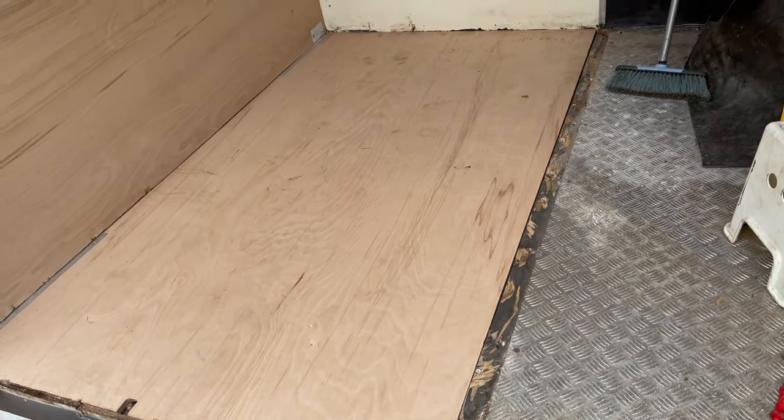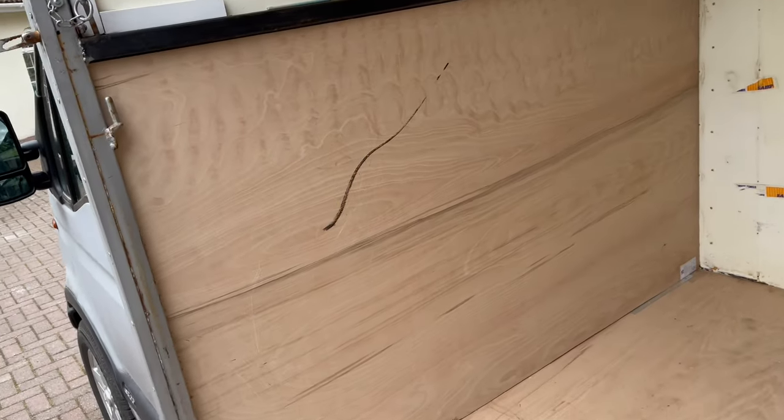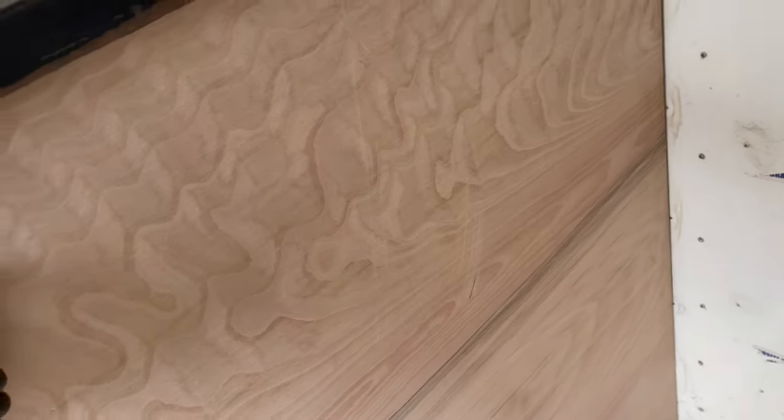It's structural and hardwood so it's extra strong compared to softwood plies. I also decided to reinforce the side - this is a 12mm ply on top of the original walling of the van. It's a bit of a compromise between strength and weight, but I think that was the right compromise for us.